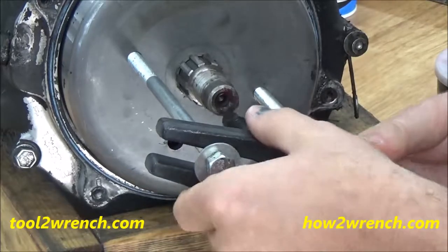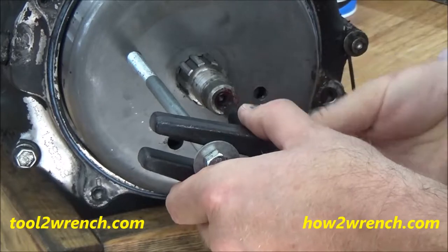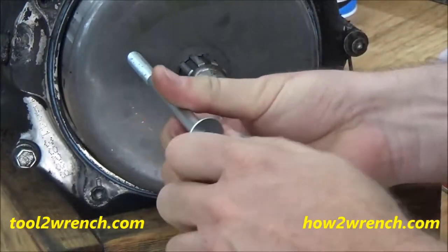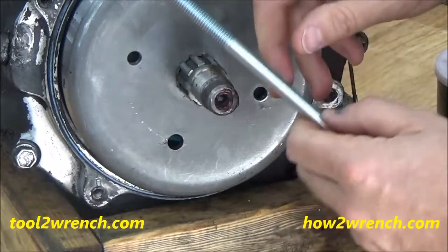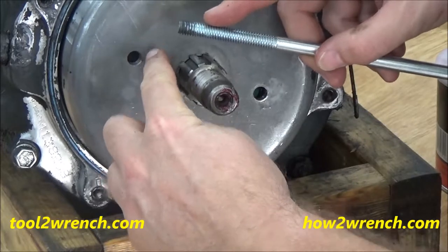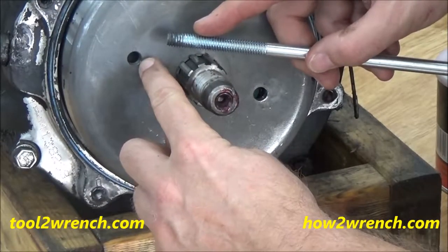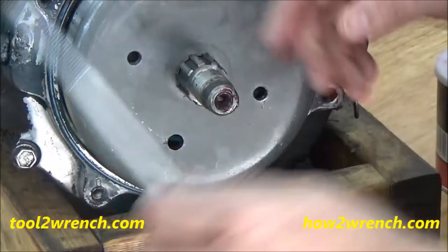That's a great alternative and this is a high quality tool. One thing that's really nice about it is it pulls the rotor off really nice and even, because when all of this is set up correctly it's just going to draw it off there evenly. The danger is that you have to be really careful not to thread this in too far. I would measure how deep the hole is with the back end of a vernier caliper to make sure you're not going to hit the stator that's behind there. If you hit the wire behind there you actually ruin your charging system component.